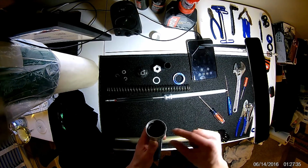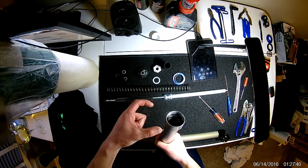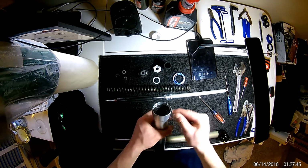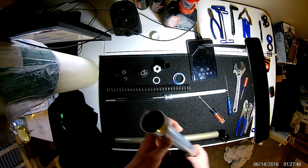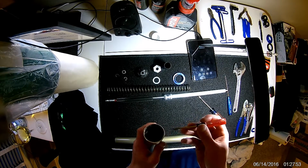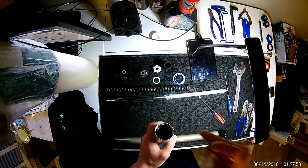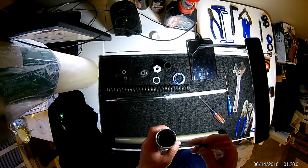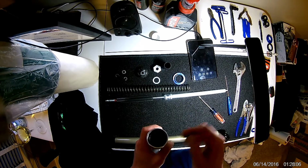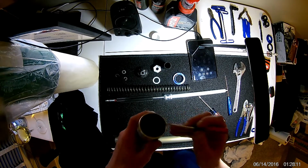Take my time and show you the best that I can. Before I start taking it off, we'll see there's a clip in here. It's almost a C-clip, compressed and then released, going into a groove on the inside of this fork tube. So again, we don't want to damage any of the surface in there, so we want to be careful. The best thing that works for this is probably a little pick, like a 90-degree angle pick, maybe with some electrical tape wrapped around it so you don't poke in and scuff the sides. But for this purpose, I'll just be using a little flathead screwdriver.